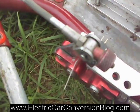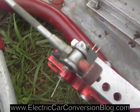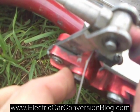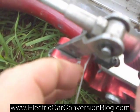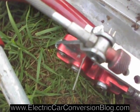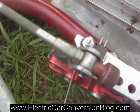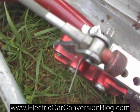Turns out the culprit for the 1.3 low voltage error happened to be this micro switch. This micro switch was used to detect whether the brake was applied or not. Normally it was adjusted so that when the brake was applied and you hear that click, that would be the point where it would tell the controller whether the brake was applied or not. I disconnected it, and the car is still safe to drive.